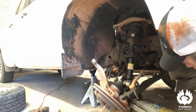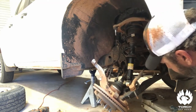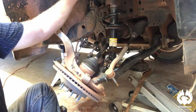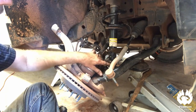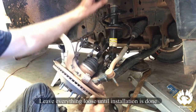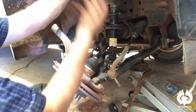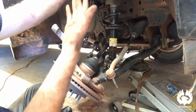Note: don't completely tighten up your top strut nuts until you get your dog bone on the bottom strut mount. I had to use a ratchet strap to pull everything into position, otherwise I'd have to undo everything up top. So leave it loose up top but on, get your bottom bolts run in, then snug everything up. Now get that ratchet strap off and raise up this lower control arm.